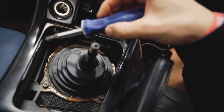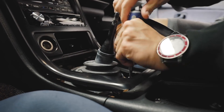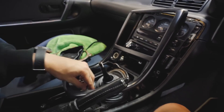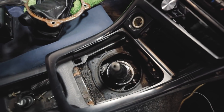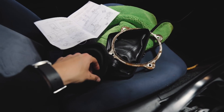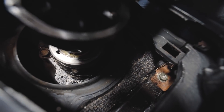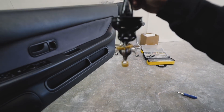There are four screws — use a screwdriver to take out all four and it should slide right out. Mine is a little crusty, probably because it's never been taken off before, so go ahead and pry it off. Now the shifter is exposed. Using the Japanese directions, I've sort of figured out what's going on. Once you get all the factory boots off, you lift up the last rubber boot on the shifter, and there's a snap ring — a special kind of clip. I used special pliers to pry that, and then you can pull out your stock shifter.